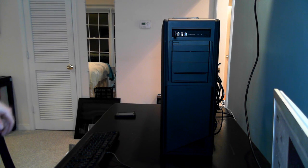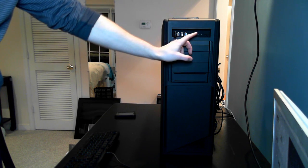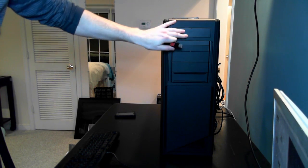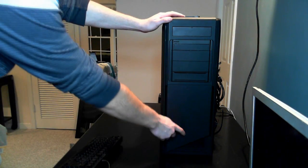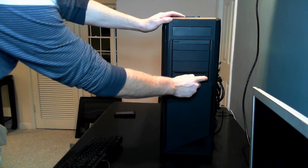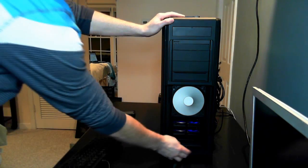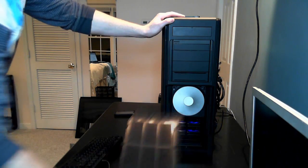The front of the Switch sports a hidden I/O bay including 2 USB 2.0 ports, 2 USB 3.0 ports, an SD card reader, headphone and mic jacks, as well as your reset button and another button that we'll explain later. There are 2 140mm fan slots up front, one of which is included. There are 4 5 1/4 bays, one of which is already in use, which we'll explain later. To remove the fan cover, push the NZXT logo. At the very bottom, you will also find easy access to your fan filters for cleaning, plus one for that.